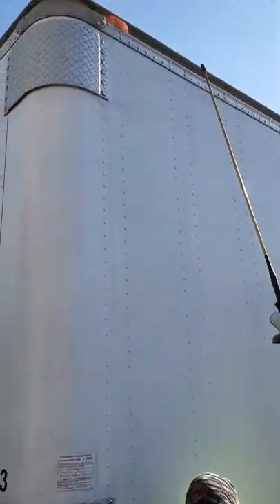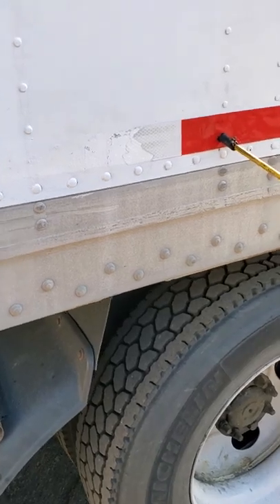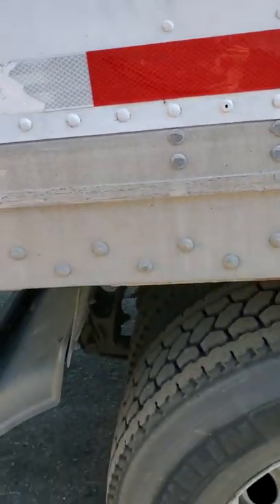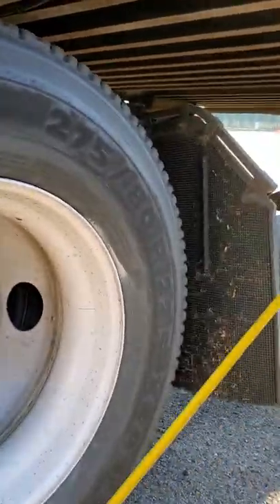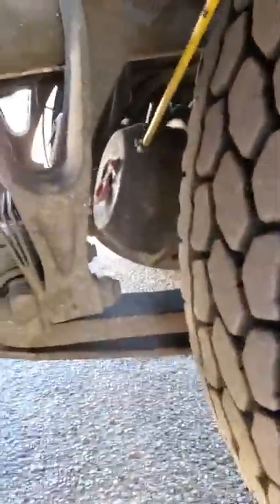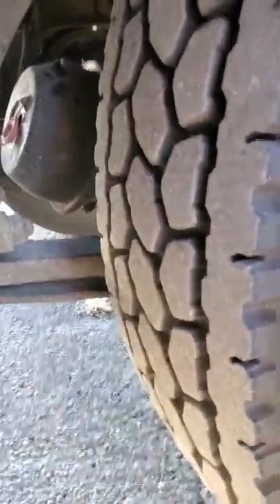The clearance lights are amber in color, not cracked, broke, or missing any lenses. DOT tape is securely mounted, not cracked, broke, or peeling. Splash guard and mud flap — securely mounted, not cracked, not hanging dangerously low. The brake chamber — brake line, ABS line, brake chamber, the clamp, push rod, and slack adjuster — I would check those like I did on the steer axle.